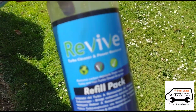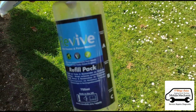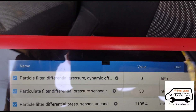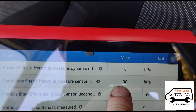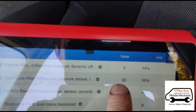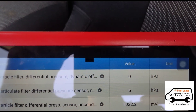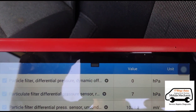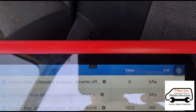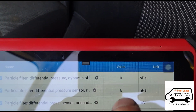So we just put another bottle of that in there just for good measure, because it's quite bad this one. Okay, we're on 30 there. Now we can release the pedal and see what it's like on idle — and we are now down to 6 or 7 on idle. So there's a lot of difference there. That's essentially millibars — 6 millibars, down from 50 to 60 on idle.